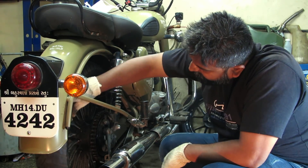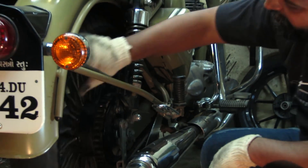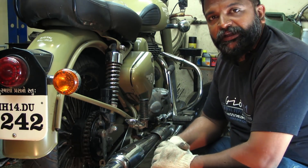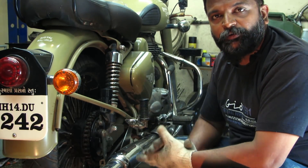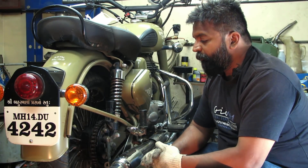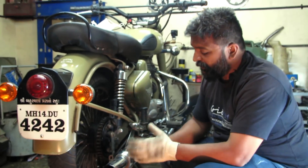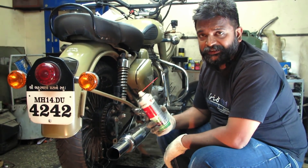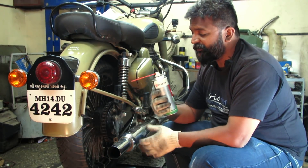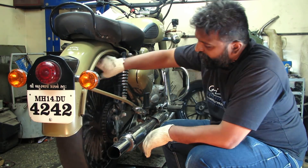As you can see, the chain is quite clean now and the chemical is acting. You'll have to wait for some time. In my last video, after the cleaner I used a cloth to wipe out the excessive grease and debris, but in this case I'm not going to do that. I'm going to directly spray lube on the chain because I'm going to redo this job after 100 to 200 kilometers. I can't keep the vehicle here for 24 hours just for the lubing purpose, so I'm using this fast-action chemical. Now I'm going to set it aside and wait a few more minutes.